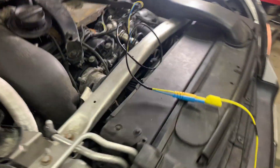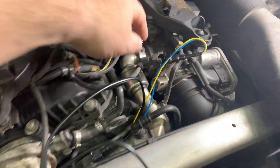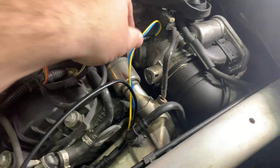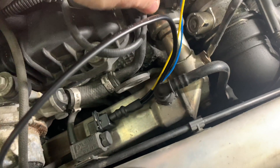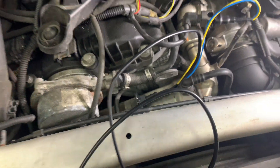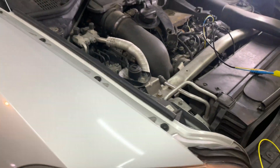We're going to take off the EGR and clean the spring and see if that helps. This was a lifesaver because there's nowhere to really scope into. So if we didn't have this breakout lead, we wouldn't have been able to test it right from the actual circuit itself. Both signals are coming in at the same. So that's it — we'll give you an update once we get going here. Thanks for watching guys.